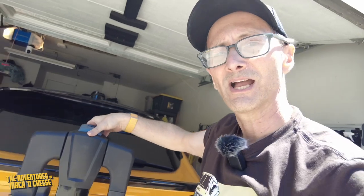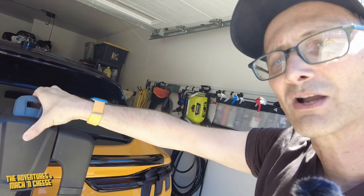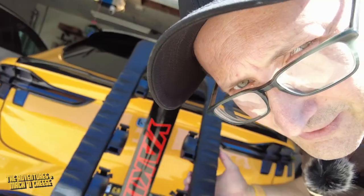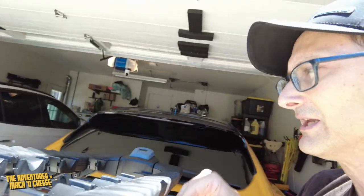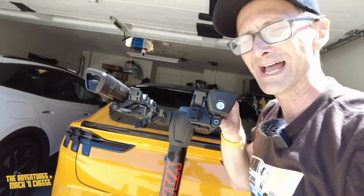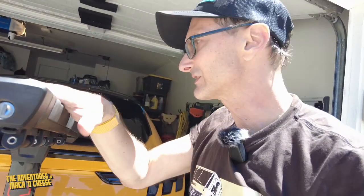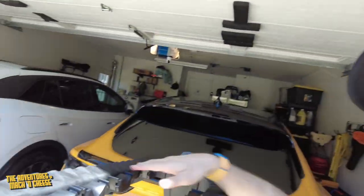But I just want to show you a little bit of how you lift this into position. So you're going to take this hinge lock over here, plastic thing on the top, pull that up. And then once you do that, the rails or the hitch ledge here becomes unlatched and allows you to snap this up into position. And now this is completely up into position, and you can see, all right, on this you can then put four bikes.